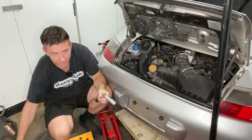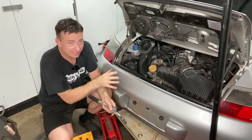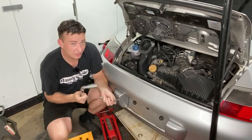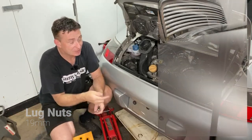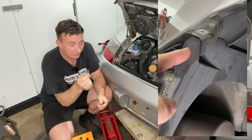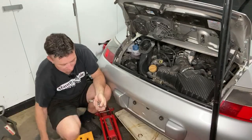To do that, it's going to be much easier if we raise the car up using our fancy new Porsche jack adapters, and then we're going to take the bumper off. To take the bumper off you need to take the wheels off first, which is much easier. We have a 17mm socket to do that. That gains access to the wheel arches where there are two crosshead screws to take out, four more crosshead screws across the top, and two more underneath.